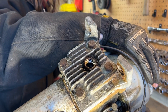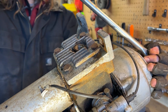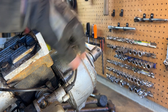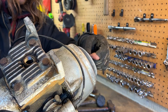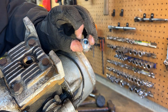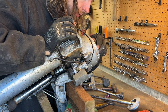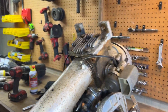I'm wondering if what I was feeling earlier was just the bolt moving - I don't want to put a ton of tension into this, giving that crankshaft nut. You guys see there's a little bit of motion on this ring, which makes me think the bottom end isn't stuck - it's all up here on the top. Just a hair of movement. Not a very robust-looking nut - we're only bearing on that little surface. Maybe I'll flip it around, install it with the flat face down so we can get a good surface to bite on. I'm calling it on that technique - we're not going to do anything, that's not going to screw it up. Let's get that cylinder head off.